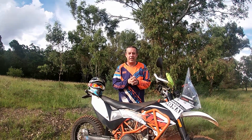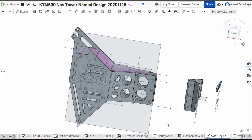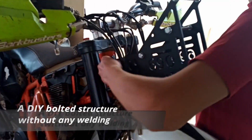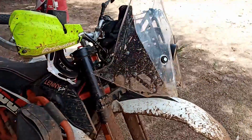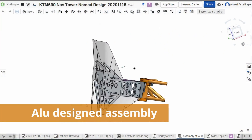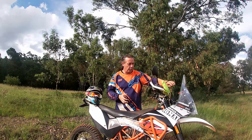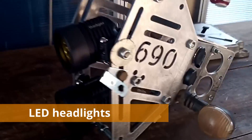This has taken me about a month. I started designing from scratch on a computer, then sent the designs to a cutting firm — they basically laser cut and bent my designs for me. What's interesting is that the whole navigation tower consists of only three components: the 450 KTM screen bought from KTM, the aluminium assembly which consists of three laser cut and bent plates, and the lights.